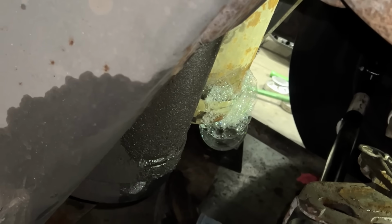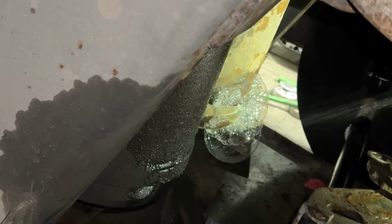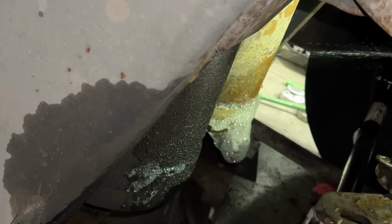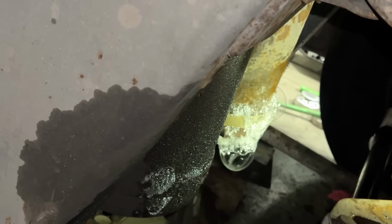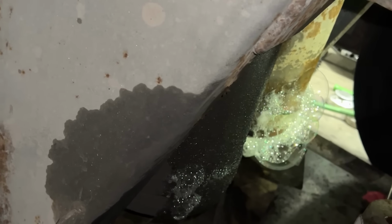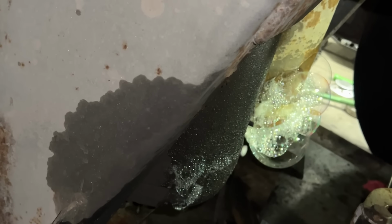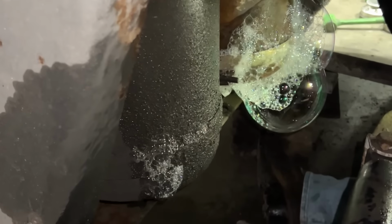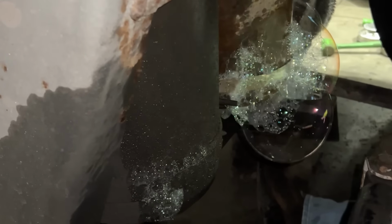So spray both tanks. The one on the left only has a slight leak, and the one on the right. And all of it. Holy cow. Oh my god. That's the air tanks themselves, where the straps go on there that rusted out. We can't weld on those or anything. That's just got to be replaced. That's our last big air leak, though, because we're only leaking like 2 psi a minute right now. It's definitely all right there.